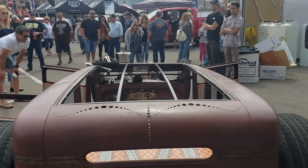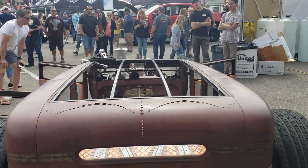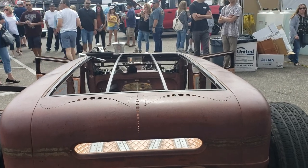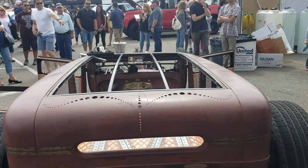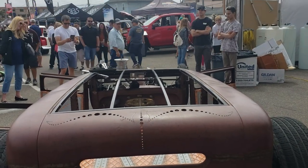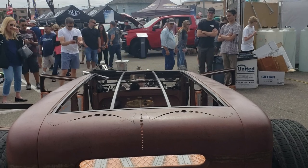The thing's got a ton of head work done by Arnold Chavs at Dos Famos machine shop — an 80-year-old living legend from Fremont. So he's done a ton of work in that thing. It's all ported, polished, valve job, shaft-mounted roller rockers, 10.5 to 1 pistons.